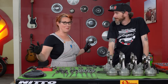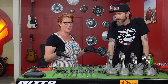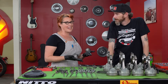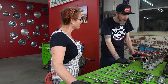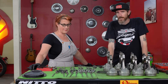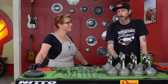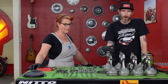So we just disassembled the small block Chevy, and as only my second engine disassembly so far, I have to say it's a lot easier than one might think. You just do one step at a time. It's great to have a master guide along with you, but really, as long as you have the steps down and some basic hand tools, that's about all you need. Just take your time, keep things in order. During disassembly, we didn't really use too many exotic tools — it was mostly hand wrenches and basic sockets. The only special thing was those spikes used to remove the pistons.